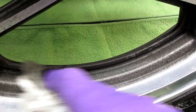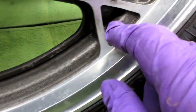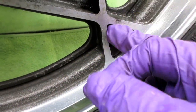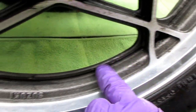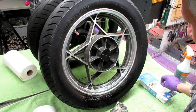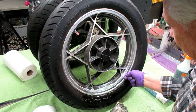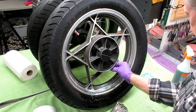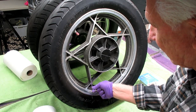Sometimes you have to do it two, three, four times. Part of this is we're going to sand this down — not as smooth as this, but enough to get a nice high-gloss finish on there. The trick is to get into all these little nooks and crannies, because where the paint is not going to want to stick is in the low valleys. The paint shrinks a little bit there and I don't want it to pop up. I need a whole box of Q-tips because I'm going to be using them. This part of the job is the equivalent of building the foundation of the house.